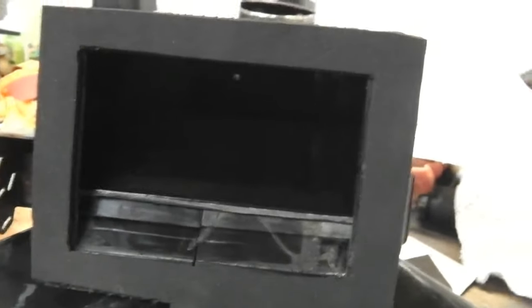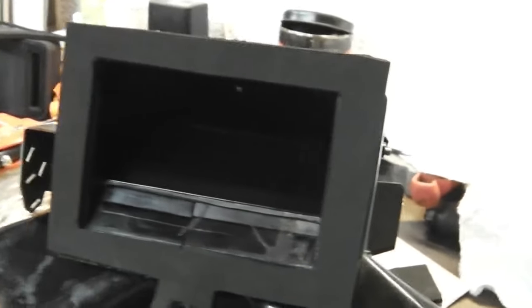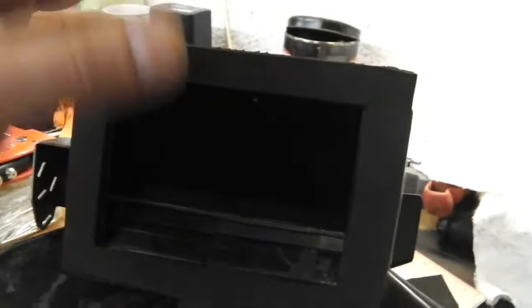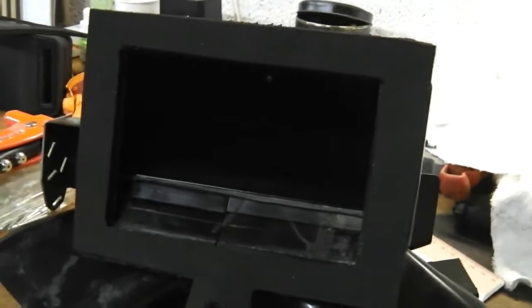But this one, I wouldn't think it, but this one is just connected on the lever to the speed control of the fan, so all the way to the right closes this off, no air can get into this system that way, so it can only now go to the fresh air vents if indeed you've got your fresh air vent open. If you have, you've got full power available. If you pull the detent lever towards you, it puts full 12 volts to the fan, and that way you're getting fresh air, full fresh air, and nothing else going to your feet or the windscreen.